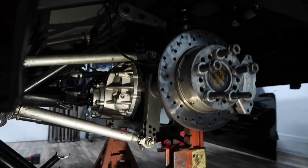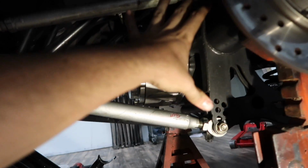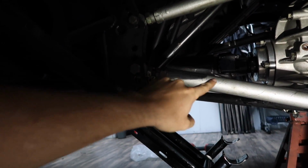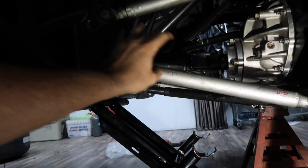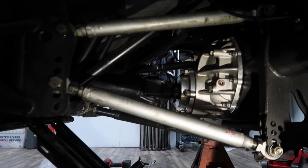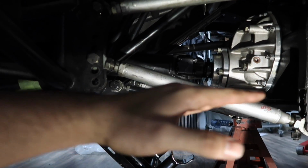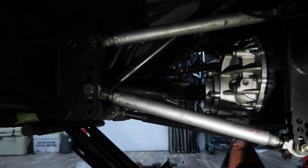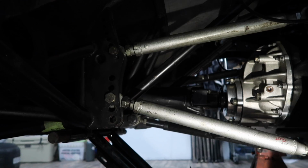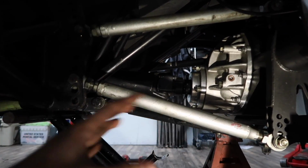Alright, so let's talk about 4-link a little bit, and let's talk about how it works. A real basic rundown of what we have here. So, as you can see, wider spread at the back, narrow at the front with some pretty good uphill on this bottom bar. When you release the button, this rear end wants to drive underneath the car. By having the bar set up like this, it makes the rear end separate. So everyone thinks as a car would leave, it transfers weight back and the car would literally sit back. Well, when you have the bars like this, it literally does the opposite. As you apply power, it makes the rear of the car stand up. And you could have too much of that, and that's what we have had. Not that there's really, every car is different, so you can have too much or you can have too little. Everyone has their preference.